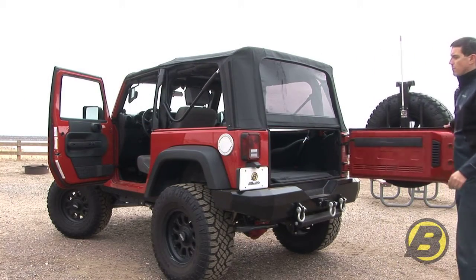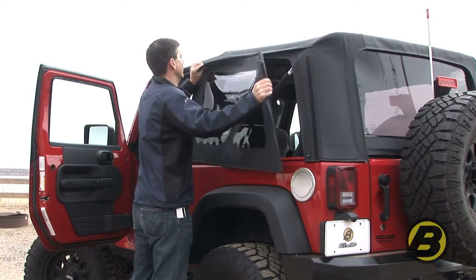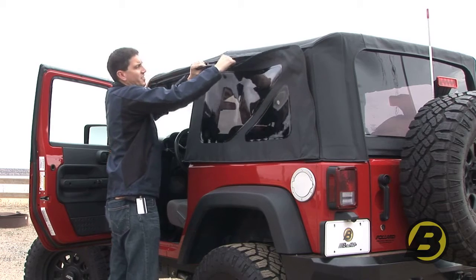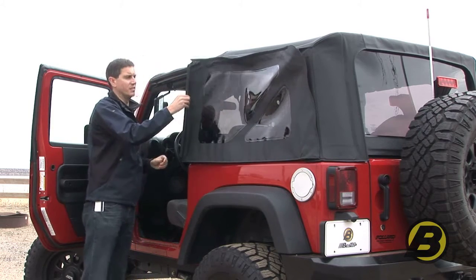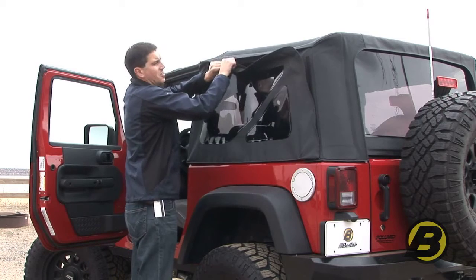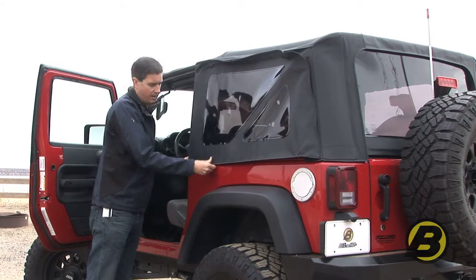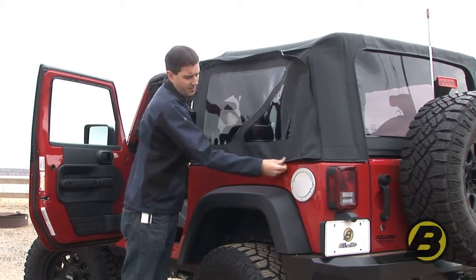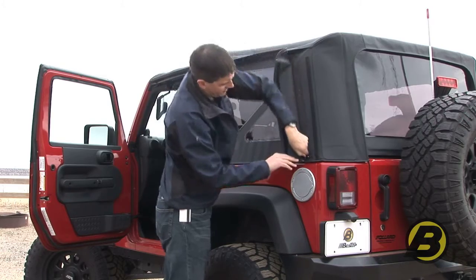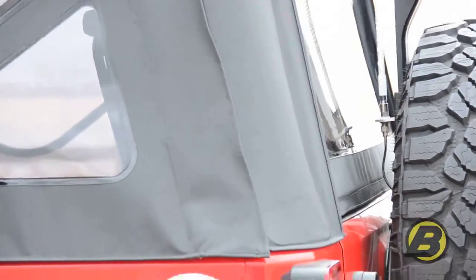Move around to the quarter window. Taking the quarter window, put it in place. Line the zipper up and hold the back end with the Velcro. Start the zipper for about the first six inches. Then take the front retainer and snap it into the door rail. Pull the zipper round until we get to the top corner. At this point put the bottom retainer in, into the belt rail on the Jeep. You can then pull the zipper all the way down. Finally, tuck the flaps in and hold them in place with the Velcro.